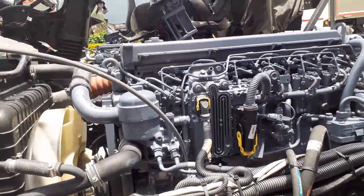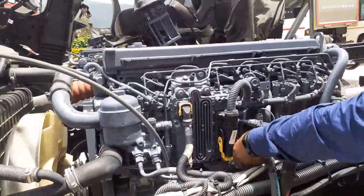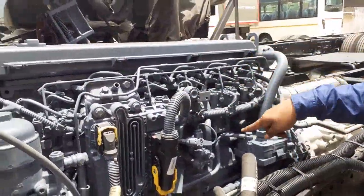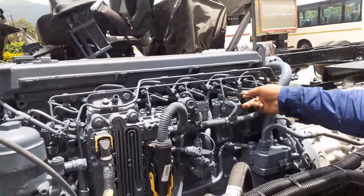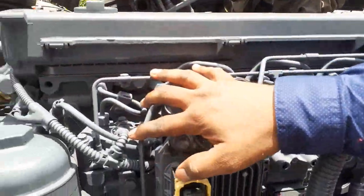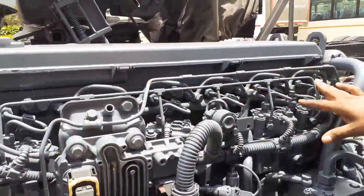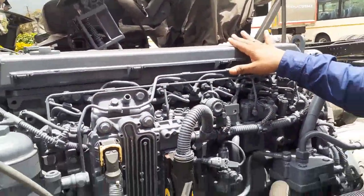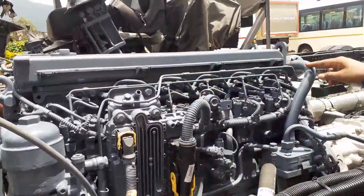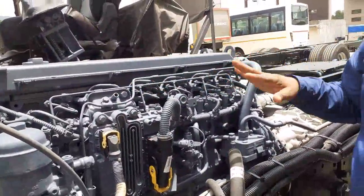We don't have CRD technology — this is a pump-injector technology. So we don't have a separate high-pressure pump and rail maintaining pressure going to the injectors. Instead, we have a pump unit over each individual injector — individual pumps for individual injectors. So even if one pump goes off, the other five pumps are still working and your vehicle can reach the nearest service station. Whereas in CRD, if the pressure goes off in the rail, the entire engine shuts off.